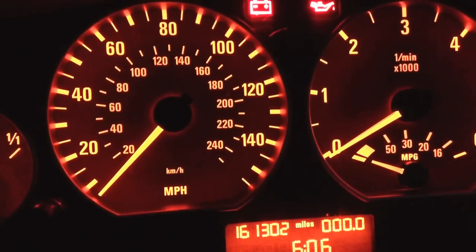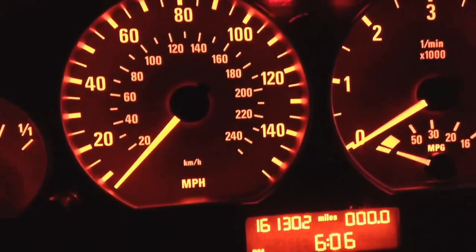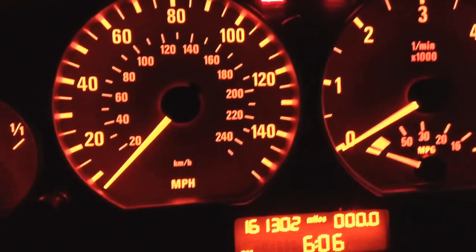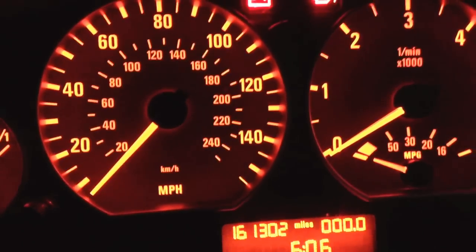Hi all, this is just a quick video to show the temperature in a digital format, as opposed to the temperature gauge needle on the right. It's basically to diagnose if you think your thermostat is sticking open, or it might be over cooling or something like that — then you can check it more accurately.